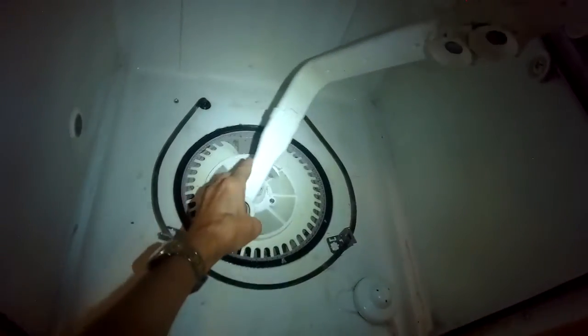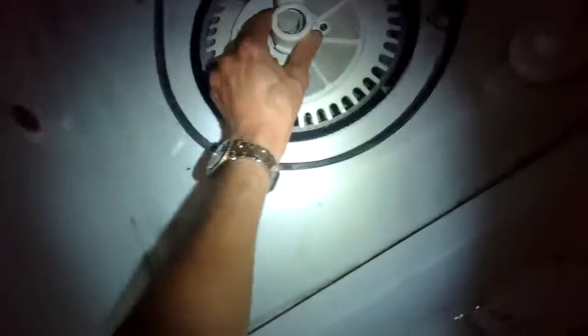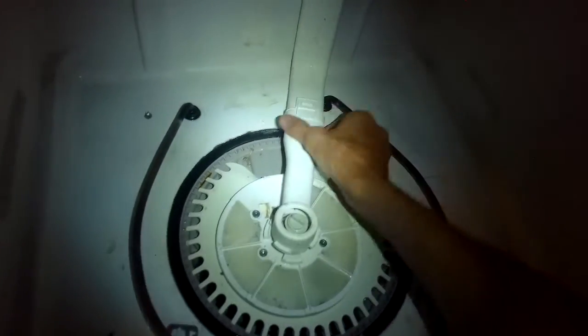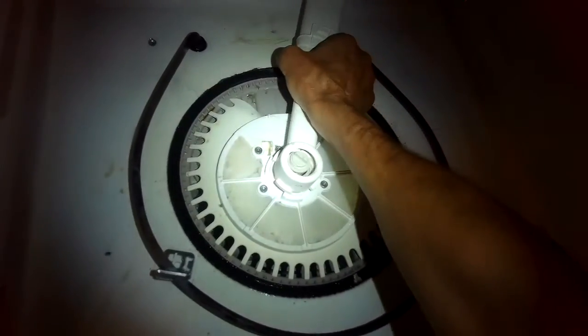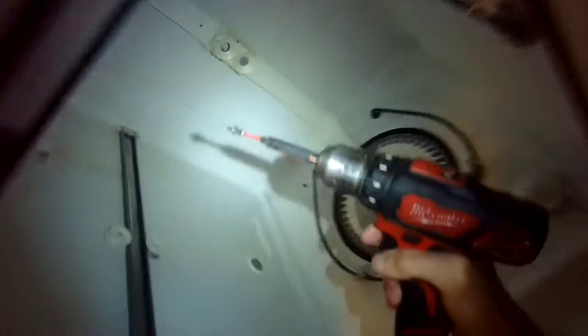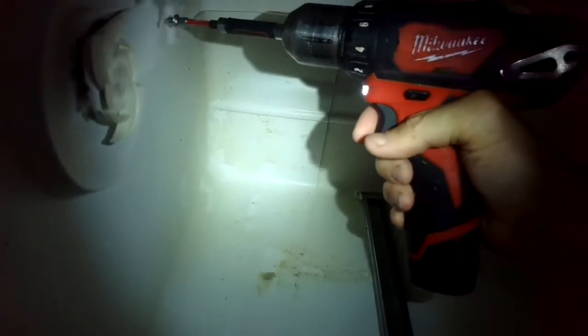I'm going to put this upper spray arm assembly back in. I'm going to come in at about 45 degrees with this thing pointed out to about 2 o'clock. And then I'll wiggle it down in. And then once I get it started, I'll swing it back to 12 o'clock. And we'll put the screws back in. Just be patient here, just gotta wiggle it around, finagle it until it lines up. There we go. Got it in position, and then I add in the 2 Phillips head screws. Put that 1 screw there at the top.